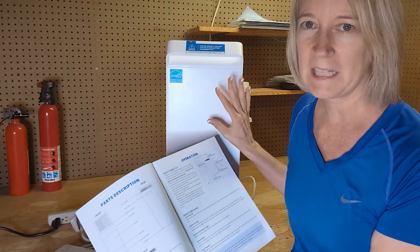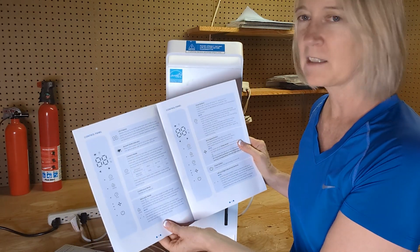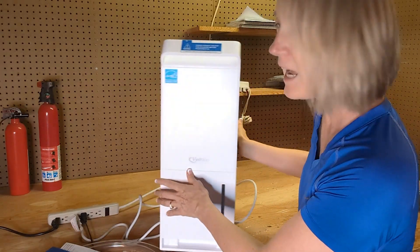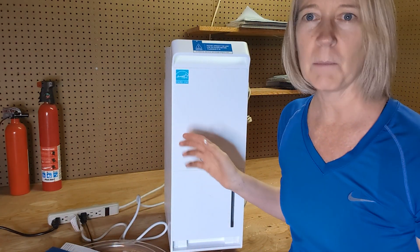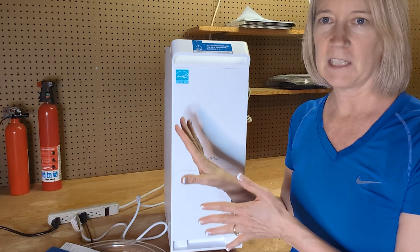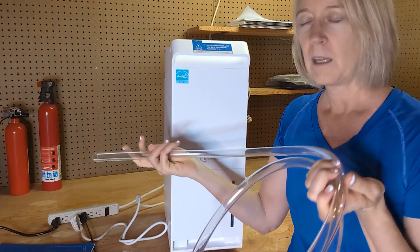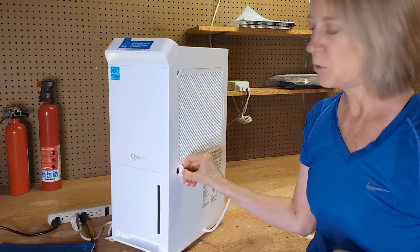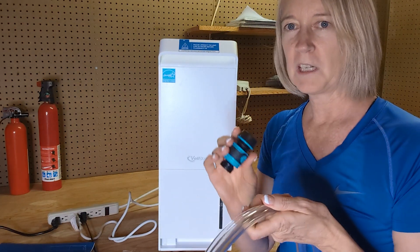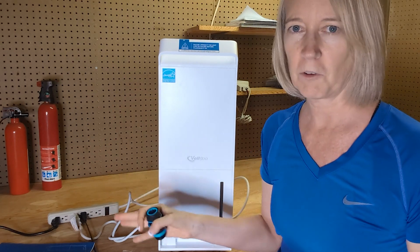You need to keep this 20 inches away from every side, so this indicates that you need to have 20 inches around you, and then this gives you your information about your controls, which I'll show you in a second. I have it right now in my basement, up on the workbench so it's easier to show you. Normally I have it by the sump pump and we do a continuous drain using this — you just pop that hose right into the side here and it drains down. The other way you can do it is with this adapter — you can put it on here and add a garden hose if you need to extend the hose further away to wherever you're draining it.